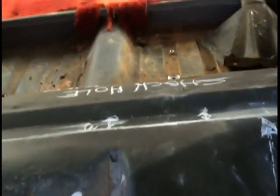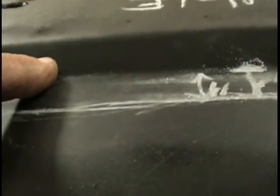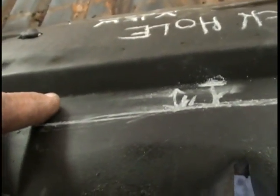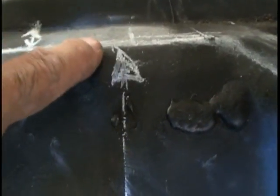If you come over the hump where the spare tire was, there's a bend, a sheet metal brake. Come 1 inch forward. Measure 1 inch forward on both ends, driver's side and passenger side. 1 inch forward. Draw a straight line all the way across from one side to the next. Stop.